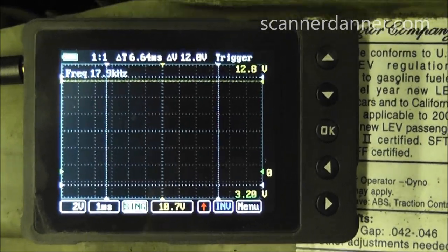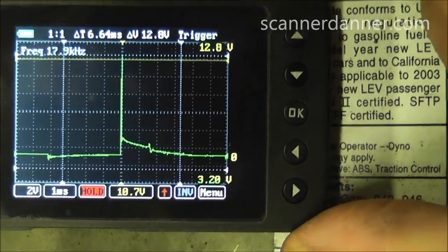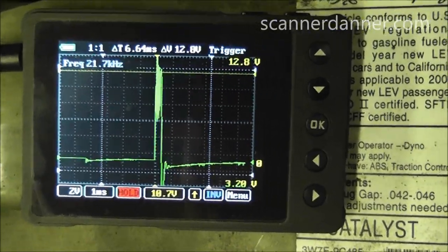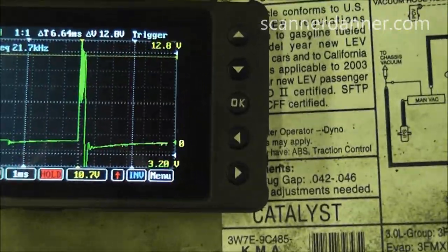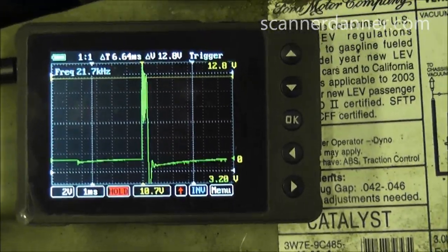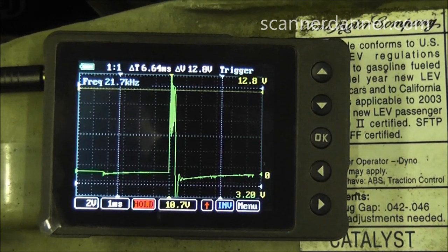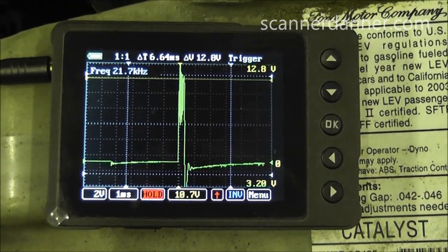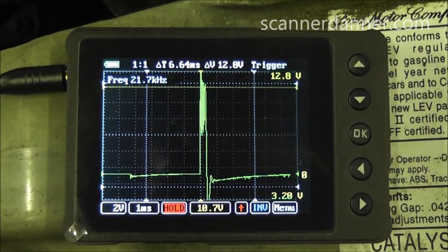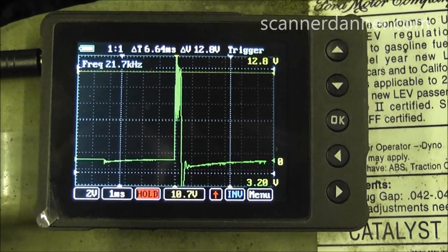You can hear the little cam sensor chirp on this engine — we're going to need a distributor for sure. It just caught that event right there — let's try that again. There is your event right there, no question about it. We have a secondary ignition problem, as noted by the spark line hash that's in here. That is a pretty cool capture, very easy to do — a nice little inexpensive alternative to some of the stuff I've been using.